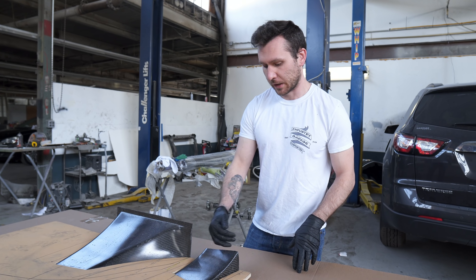If I'm going to make another one of these for someone else, it's so easy to design — I can just make it off of a front bumper template or anything. As long as you know where your wheel placement is, you can design it pretty easily. All of this foam is going to be inside as support — it'll be a core material. So it'll be a piece of carbon, this foam, and then a piece of Kevlar or carbon Kevlar on top.